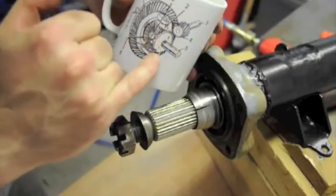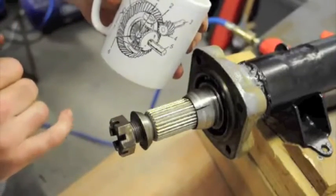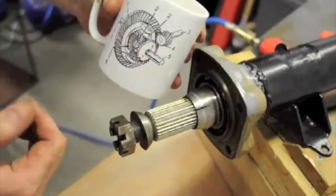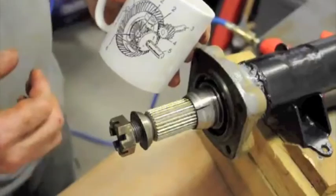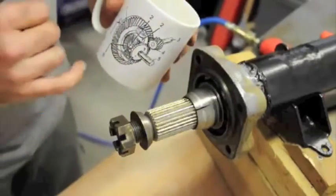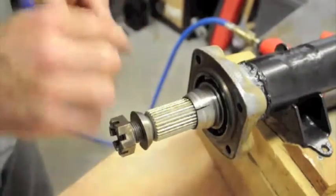disc behind it, the thrust washer that's made of fibre, can be replaced to stop what's called clunking, which is when the car takes up drive, there's a sort of clunk from the rear final drive. So I want to get rid of that. I want to get that replaced before I bolt this axle onto the Cobra. So those are the reasons I want to do this.